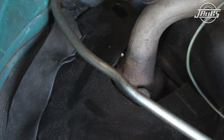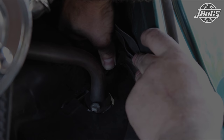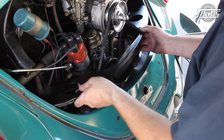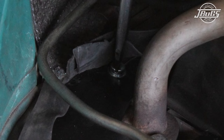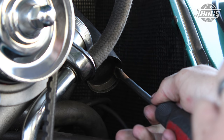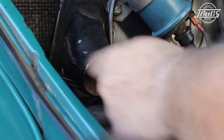In the engine compartment, we'll have to change out the rear engine tin as it doesn't have the holes for the fan shroud hoses. There are usually two screws at the outer edges of the tin which may be covered by the rear engine seal. In our case the screws weren't installed, so we just remove the nuts and bolts for the rear engine tin near the crank pulley and pull the old tin out. We set the new rear engine tin in place, pull the rear engine seal up and over the tin, then install the outer shroud screws as well as the screws, nuts and bolts at the pulley tin. If your car has them, remove the fan shroud plugs with whichever tool is appropriate — in our case the plugs were just pressed in place so a large screwdriver works to push in an edge so they can be removed.